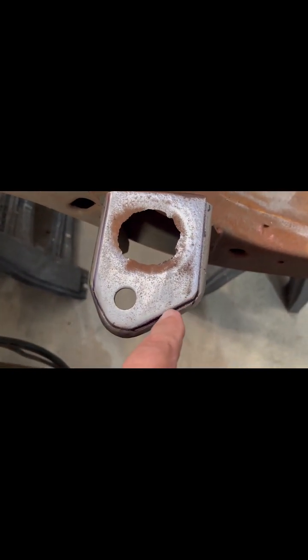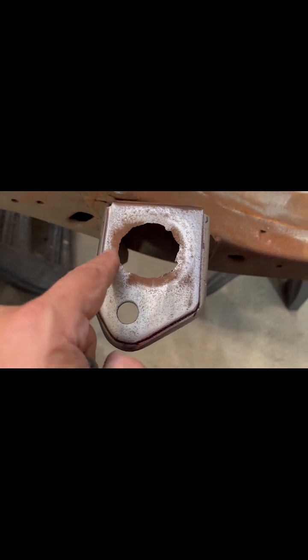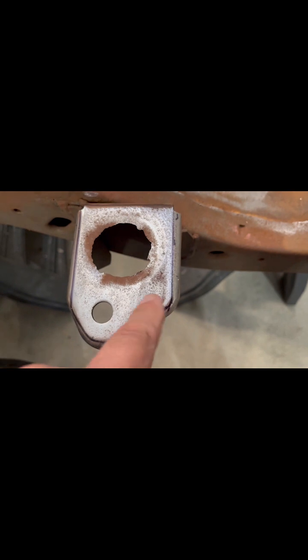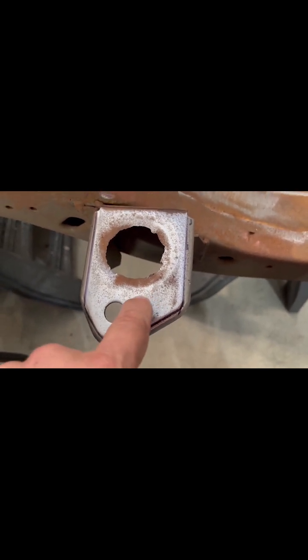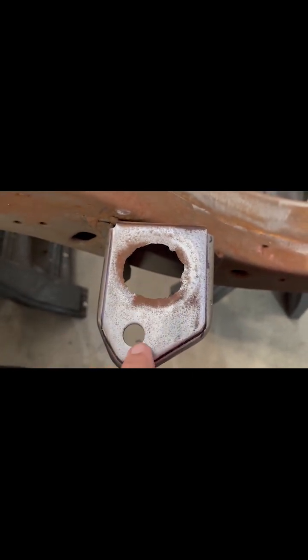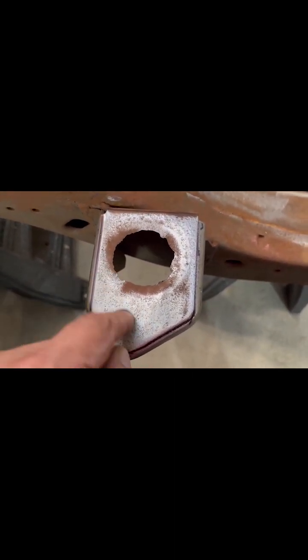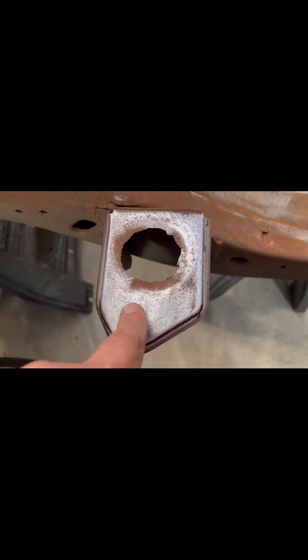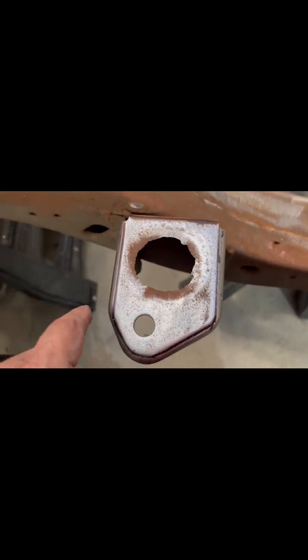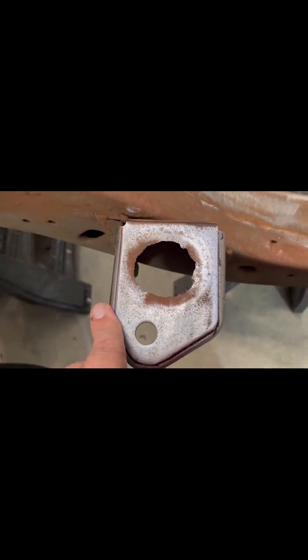So now I've got to take this off. That's warm. And I've got to cut along each of these lines right here, because this is paper thin out to about here. So paper thin way out here, and it's supposed to be 1.5 inches, and that's probably a 2-inch hole right there. But this is nice and solid, so I got a good locating mark there. So I'm going to get this all cut out. We'll set the other one in there and tack it in place.